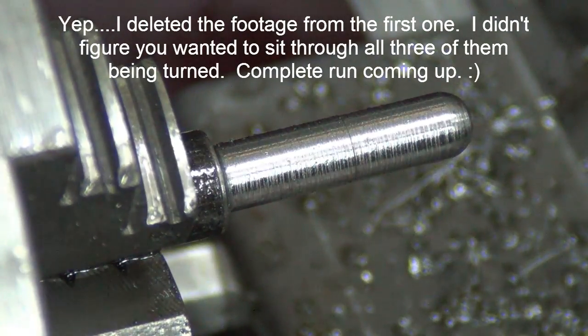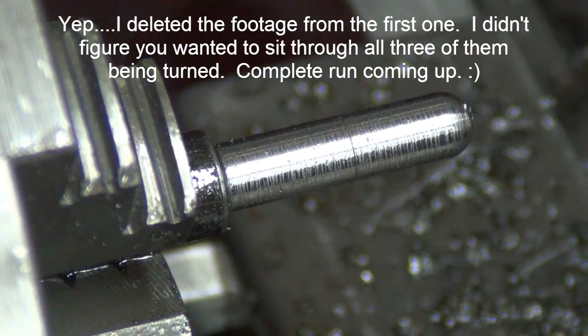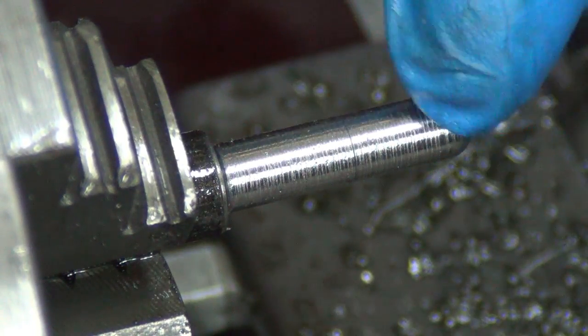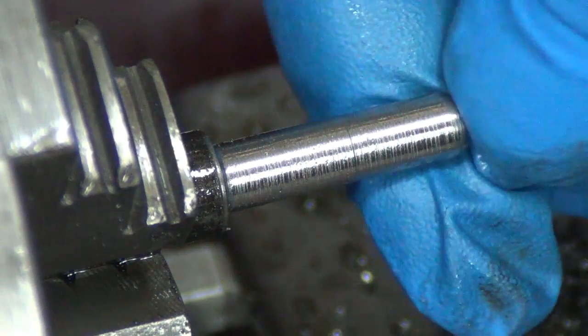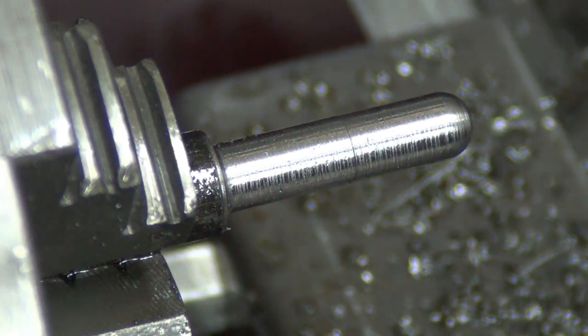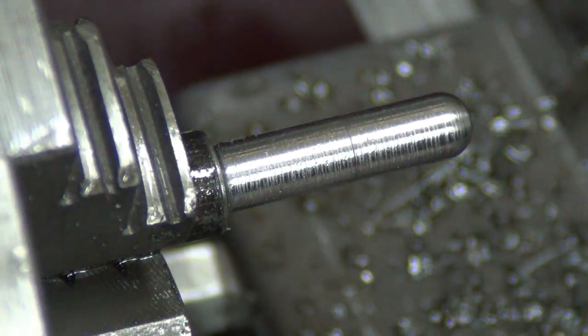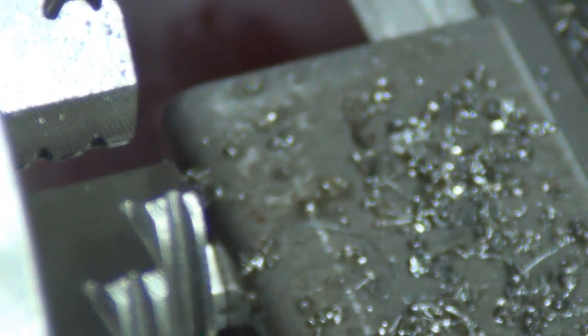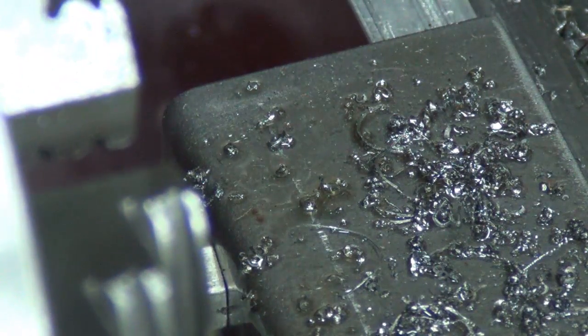There's a tiny burr there — that tiny tip is gone. The reason we're running up around the edge here is because I was having trouble getting it to blend right at the end. I'd rather have it blend in and have a tiny step up where it won't wear on the cup of the master cylinder. The bevel wasn't expected to be perfect — it was just there to knock off any sharp edge or chip. I like that; I could live with it quite easily.